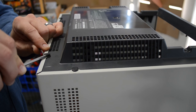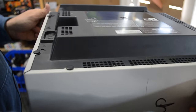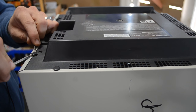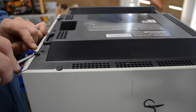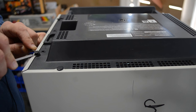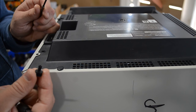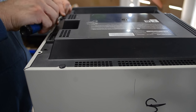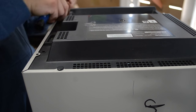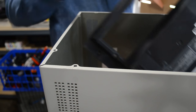When I'm taking this apart, I always alternate sides among the six rivets, because if you don't, you could put stress on one side — if you just start taking off one side, the other side will still be in place. You could break these rivets because they are plastic and they are typically 20 to 25 years old, so you don't want to break them and have to find replacements. Just take your time and that's how it's done. Okay, there you have it — safely removed.